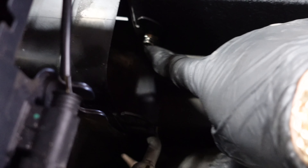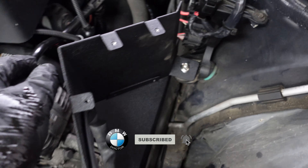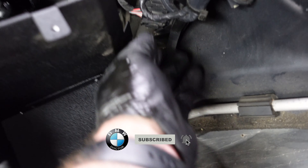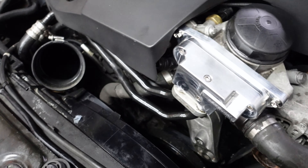We've now got the bolt located in here and it just bolts onto the plastic intake pipe right there. If you'll see from behind, it's just held on by a washer, a 10mm washer, 10mm nut, and it just bolts straight up. This is how the first piece all secures in here. You'll see it just balances on the rubber grommet in there, and then we're going to put the other one in there and close up the cap once we've got the intake system on with the pipe.